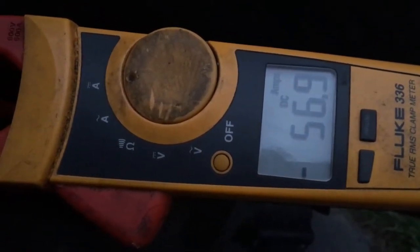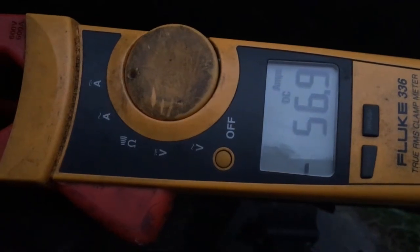Let's go in and check the voltage at 45 minutes. I can barely see it — 13.7 here, probably 13.8 at the battery. 56 amps. Charge port at 45 minutes: 14.48. Battery terminals on the converter at 45 minutes: 14.42.